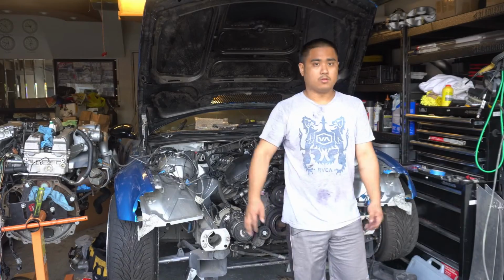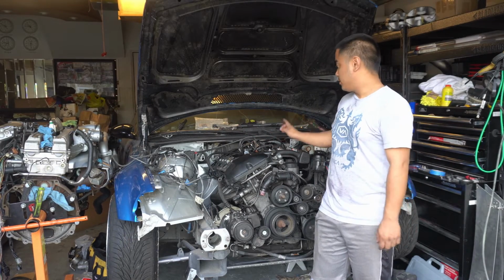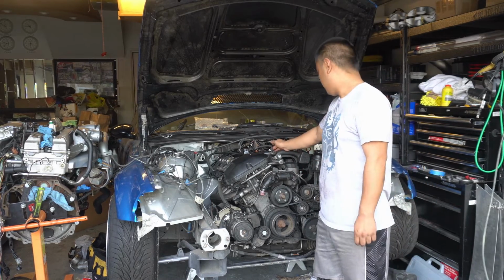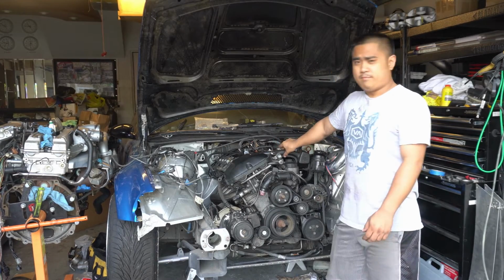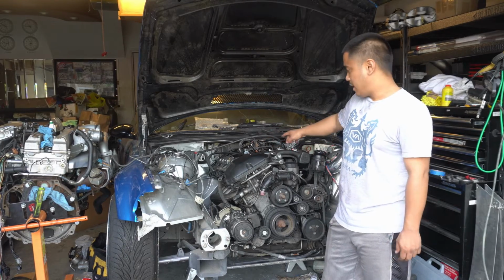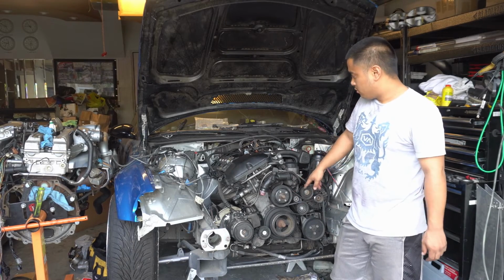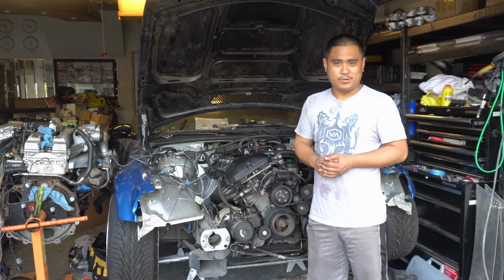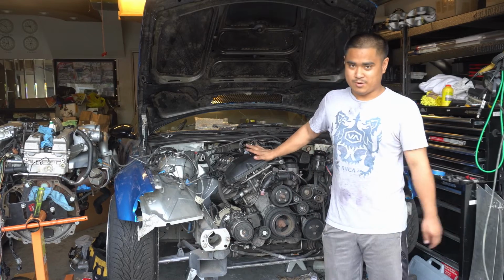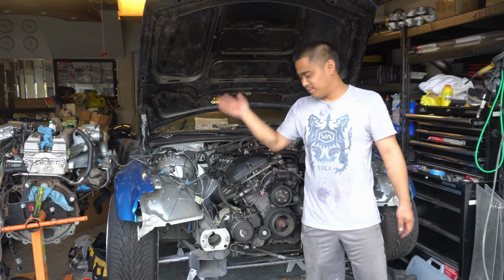Alright, so we have the intake manifold on, the vacuum line for the fuel pressure regulator is hooked up, fuel line is hooked up, the injectors are hooked up and mounted, M50 manifold is mounted, MAF sensor is somewhat wired in, just enough to get the start in, O2 sensor is plugged, and I got the serpentine belt on, so this thing is pretty much ready to rock and roll. Spark plugs are in. I think the last thing we need to do is the fun stuff. We're going to dive into the MS43 and we're going to change some parameters, so hopefully we can get this thing started up for the first time. Well, I need to add oil and fuel and prime the motor and stuff, but